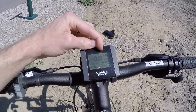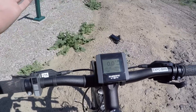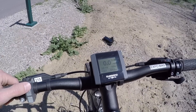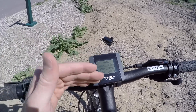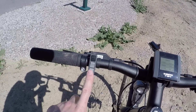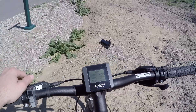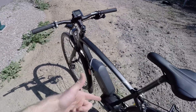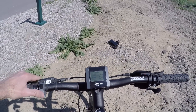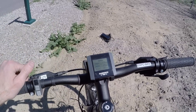The display shows speed in miles per hour, a battery icon with five increments, and a secondary readout you can cycle through by pressing the black button: time, average speed, max speed, distance, odometer, and range. There's a really cool range readout that approximates how far you can go — in Eco mode it estimates 31 miles; in the highest assist level it says 23. That's about a 10-mile drop because the motor works harder and drains the battery faster. It's a handy heads-up if you need to decide whether to stay in Eco mode to make it home.